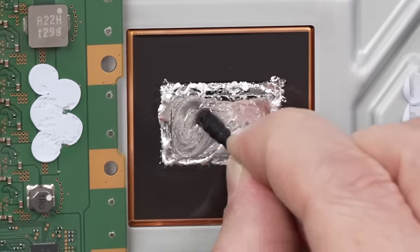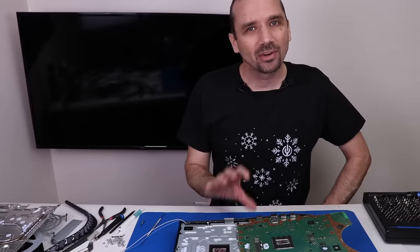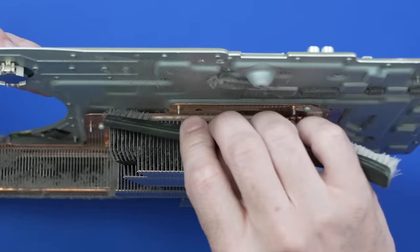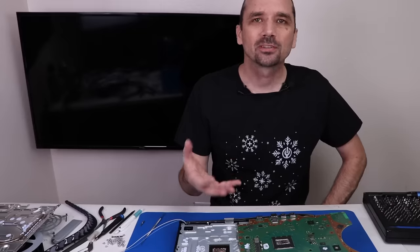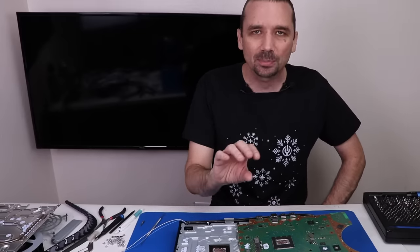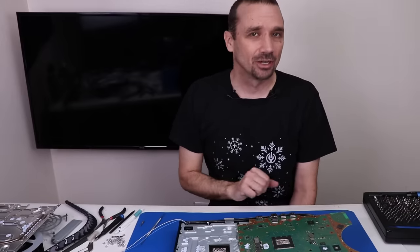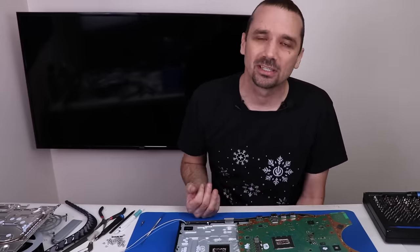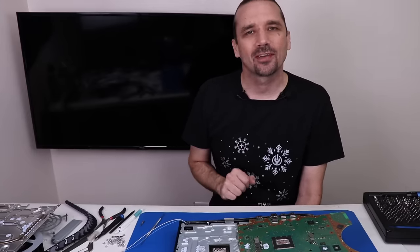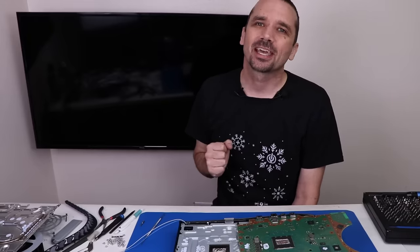I would say if you're using this a lot, maybe once every one to two years. We also definitely found today that PS5s are very sensitive to overheating and very sensitive to having the heat sink and power supply plugged with hair and dust — the PS4 was less sensitive to this. On the PS5 it doesn't always give an overheating message, so if your PS5 is randomly turning off you might want to give it a good cleaning. I have a video showing you exactly how to do that which I'll put up on the screen now — go check it out if you need to clean your PS5. Thanks for watching and I hope you have a good one.